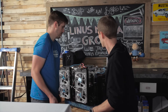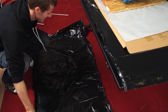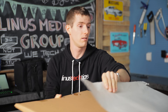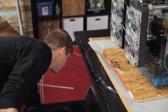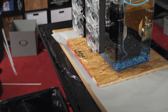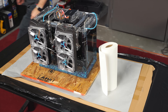Step 2 is to prepare your workspace for the tank itself. Garbage bags are a cheap, spill-proof cover material for the table and floor where you're working, but I'd recommend also creating a ridge around the outside of the area and pairing them with cardboard or newspaper to absorb excess spilled oil in case it drips off the edges of your bags. You'll also need a place to put the internal computer components. Make sure you've got lots of garbage bags and lots of paper towels on hand.